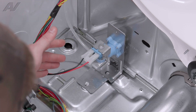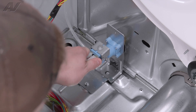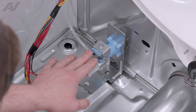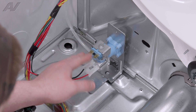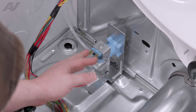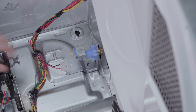There's not a good way to test for voltage down here at the component, as you're pretty much going to have it ripped apart, but you can test for ohms on the solenoid. You should have around 1250 ohms. This is not saying that it is good, but if it's way out of range, obviously it will need to be replaced.